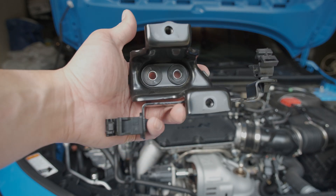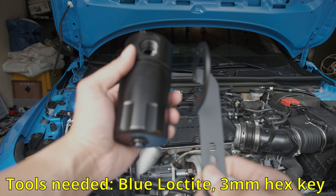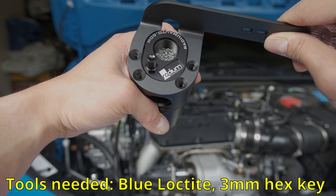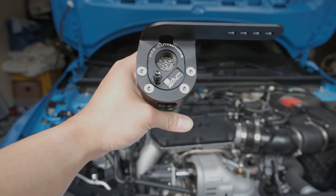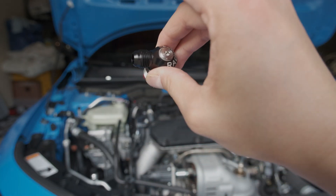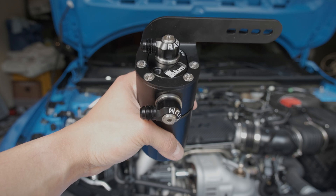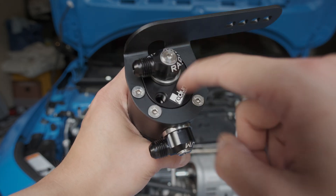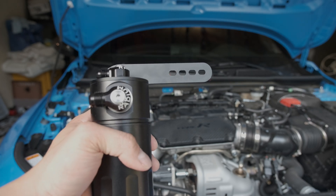This is where we're going to be installing the catch can bracket. When we install the catch can onto the brackets, we're going to need to use medium strength Loctite — the blue kind — for the four screws that go in here. Now that the catch can has been installed with threadlocker to the brackets, we're going to install the banjo fittings onto the catch can as well. One tip: if you want to install this, put the banjo fittings on first before the bracket, because this one won't rotate — it's going to hit the bracket.